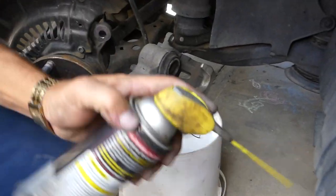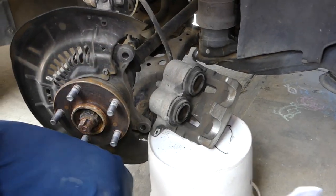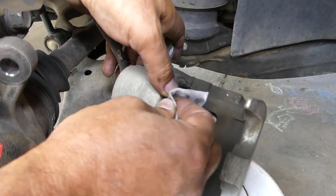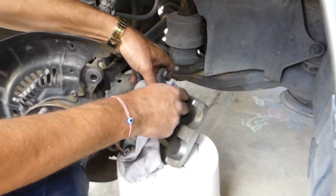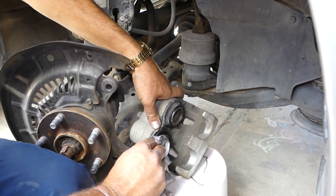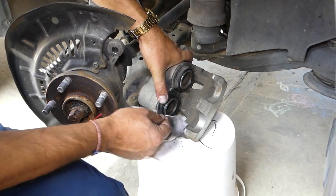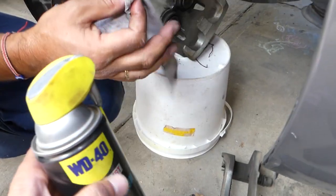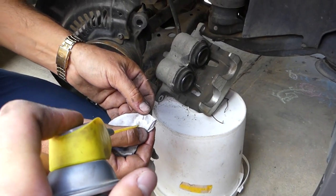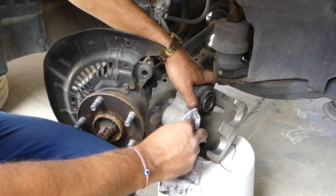You can see how shiny it gets and how well it cleans everything — just make sure there's no sand on the surface. We'll clean both pistons and after that use a little bit of white lithium grease to cover the area. All the tools and parts we use will be listed in the description of the video for your convenience.